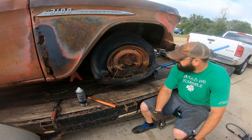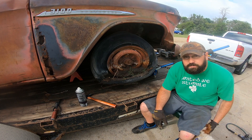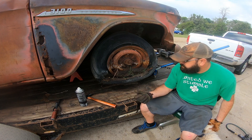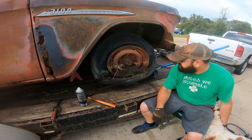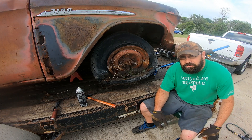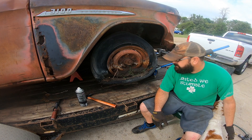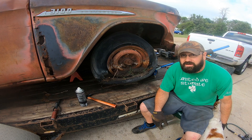This is a trick I've used before. Somebody's probably gonna get mad because I'm gonna ruin a few parts, but we're gonna replace those later. Usually I like to spin the lug nuts off — that's where I start — but these ones are so rusty and a couple of them are already missing, so I think we're gonna use the old liquid wrench and heat them up first, see if we can try to save them. Because without any lug nuts or wheel studs, there's really no point in making it roll because you can't put a wheel on it then.